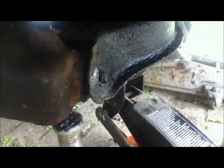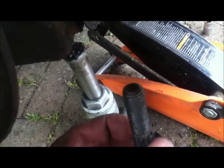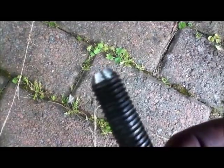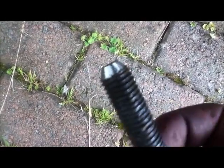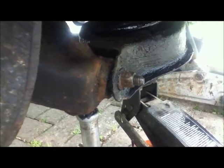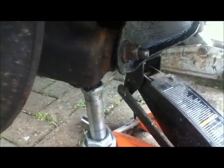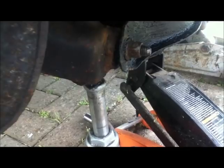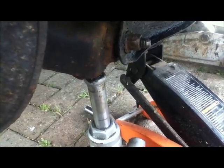The other side is all back together except for the bottom bolt, which I cannot get through. I've realised the bolt on the other side had been ground to a point to make it easy to drive in, whereas this one has a flat head — so I'm just going to grind a point on it to drive it through. I've also checked it with a nut to make sure it still threads, because it'd be really disastrous to drive it all the way through and then find you couldn't do the nut up. With a combination of putting a point on the bolt and moving each part using my little bottle jack, I've managed to get it through — but you need to watch out for that; this side was a complete nightmare.